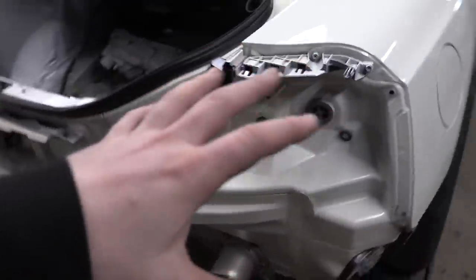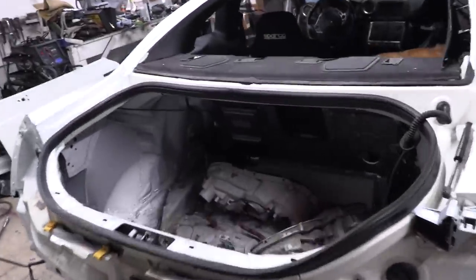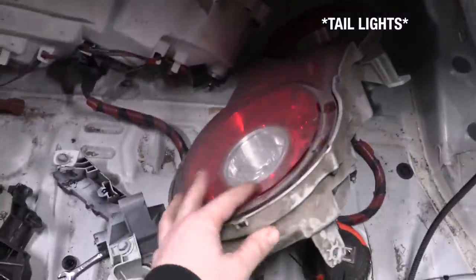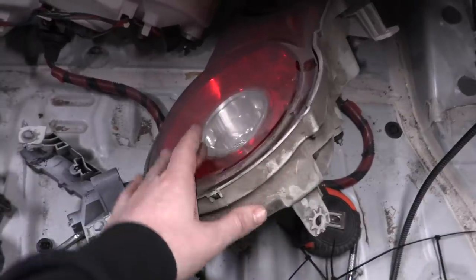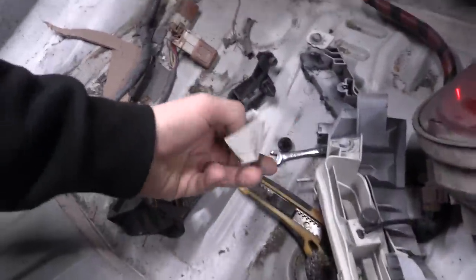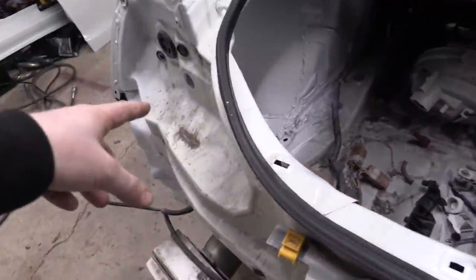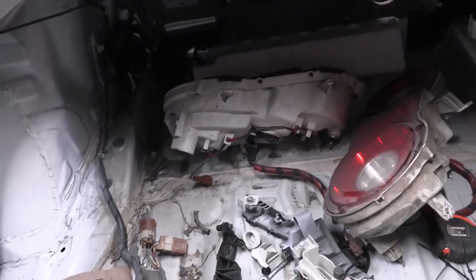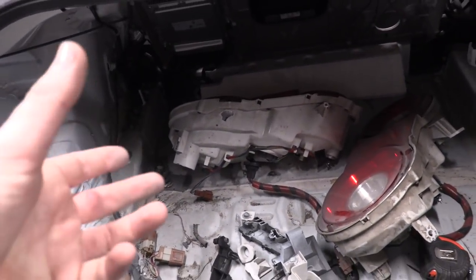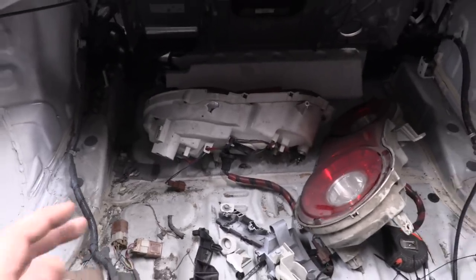We got the car into the shop. We're gonna be working on this back area here, trying to get everything really looking clean and more like a GTR. To do that, we need to do a little bit of cleanup on the tail lights — they got a little overspray, just some dust, not actually stuck. And a tab broke off of one of these, maybe two tabs, when the accident happened on this tail light. So we got some plastic weld stuff and we're gonna weld those up really good. You want to make sure that your housing doesn't have any holes in it for condensation to get in, and it's good to have all your mounting tabs.